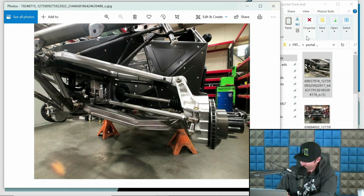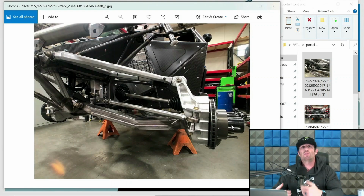You will notice one thing that is a big difference between portal setups and non-portal setups, and that is the relationship of the axle and the lower arm assembly. Your axle now enters the upright further up. The lower arm assembly is below that, but the lower arm is now on center with the hub assembly, which is the same that we have in rear-wheel drive setups. What this allows designers, builders to do, is provide a setup like this that has better ground clearance, a cleaner or more appropriate cycle with your camber curves and other characteristics, as well as giving you better travel.